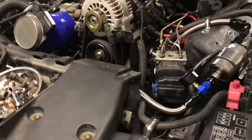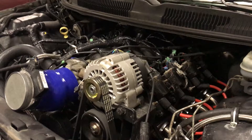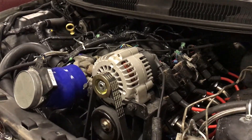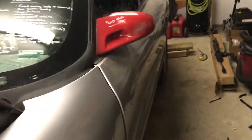I got the third gen driveshaft on. The transmission in this car is a stock S10 4L60 out of a 2001 S10 two-wheel drive — those are the LT-style transmission, meaning the bell housing is about three-quarter of an inch shorter. It also has a 298mm torque converter versus a 300mm on the LS-style 4L60. When you hook that transmission up, you lose three-quarter inch on the yoke engagement with the driveshaft. The fix is to grab the third gen Camaro or Firebird driveshaft and hook it up to your fourth gen yoke — problem solved, fits perfect.